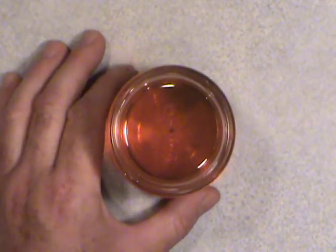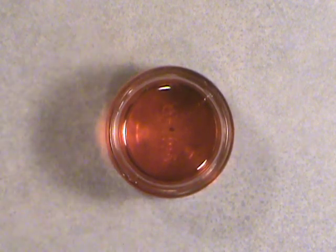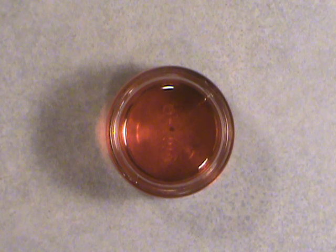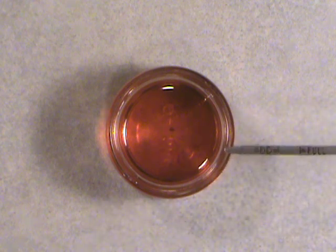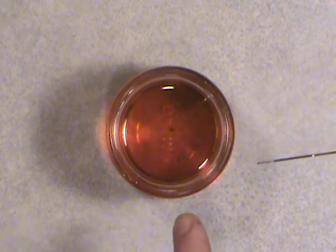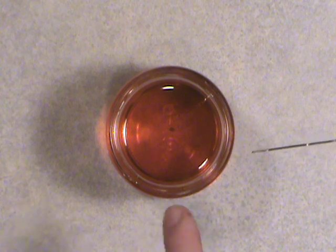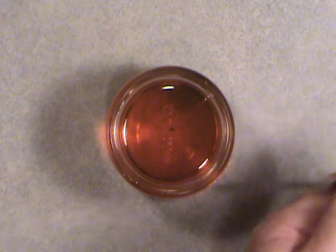and we're going to get some real oil happening here. I've got a little jar full of, it's not standard oil for engines. This is actually differential oil for your rear axle. It's 80W90. 80 goes as low as an 80 in winter, and it acts like a 90 weight, a heavier oil. The reason I'm using this heavy oil for this demonstration for engine oil reading is because it'll stick to the dipstick better. It won't run off on me as fast. But in general terms, a new engine oil will be kind of an amber color. It might not be quite as dark as this gear oil, but now I'll show you what we got going on here.